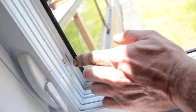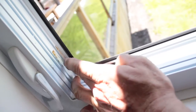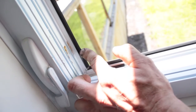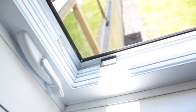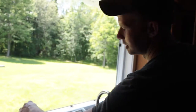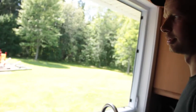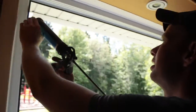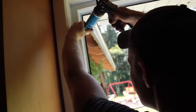There's a rubber seal on the outside that also seals up against the window frame, plus the strip on the inside. You can silicone it all the way around if you want, but it's not needed because the rubber is actually the seal. Maybe if your windows are a lot older and that strip is worn, and this is the last time you'll ever work on it — but otherwise, just a couple of dabs is fine.